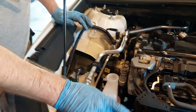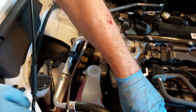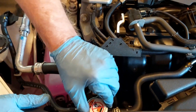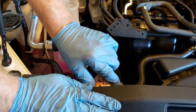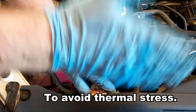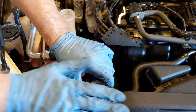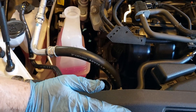Back up on top, I'm going to undo the radiator cap. You want to do this when the engine is cool, because when it's hot it can be under pressure and you can burn yourself. Also, you never want to add new coolant to a hot engine — only add coolant when the engine is cool during your initial filling. Here's the radiator cap.